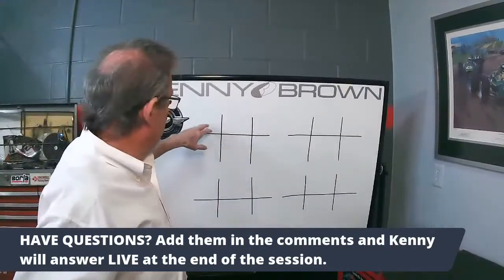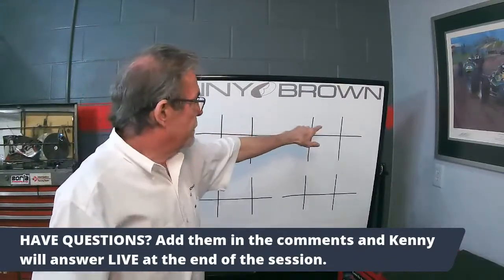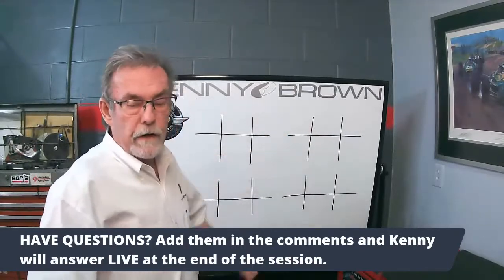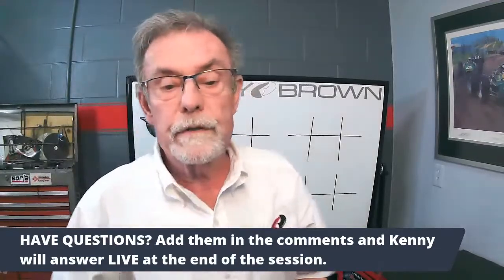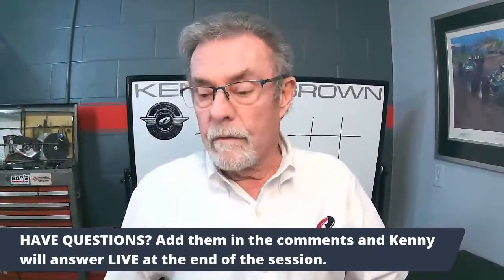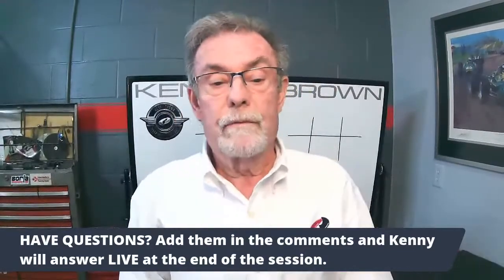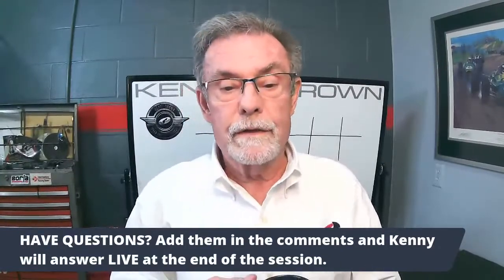Put the tire temperatures like outside, middle, inside, outside, middle, inside, for one run, and then we'll make the second set of temperatures based off of the pressure adjustment. So that's all part of my teaching how to work tire pressures, how to use tire temperatures to get your pressures right, and then also adjust your suspension. And that's taught in the Speed Therapy Academy. Is that correct? Yep, that's part of the Speed Therapy Academy.